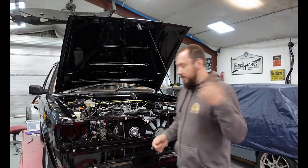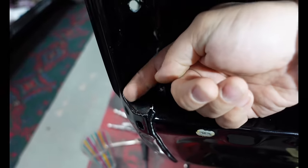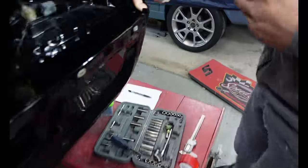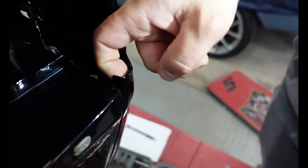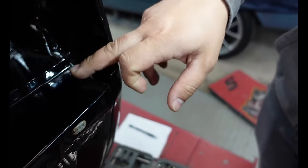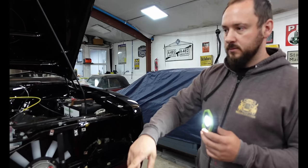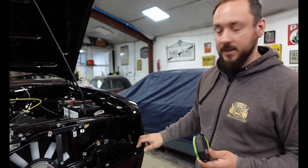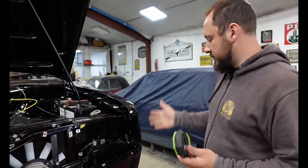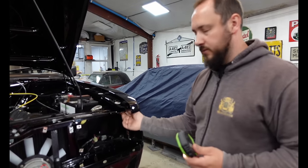Bring the camera and let me show you — look at that, not very far down at all, just off the top of there. Whereas on the other side it's loading lower. So when somebody lined up these panels — which they were lined up when they painted the car — this wing was sitting higher than that wing. That's probably half of our inaccuracy right there. So we're going to do a little modifying because this bit is in the wrong place.